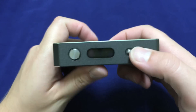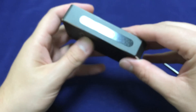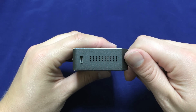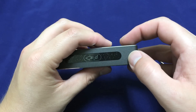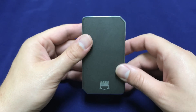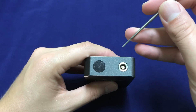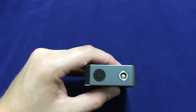The buttons are very clicky. The edges are nice and smooth. We've got the same Pioneer For You logo design on the back, battery venting, and a micro USB port strictly for upgrading firmware. You will not be able to charge your batteries through this device — there is no charge port, where the previous version originally had one and now it's just removed. So you will have to remove the batteries from the device to charge them. We do have a spring-loaded center pin with a little slot — avoid the temptation to turn it with a screwdriver as you will damage the wiring. Relatively stiff springs, so we should get good conductivity.